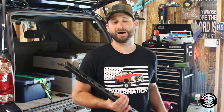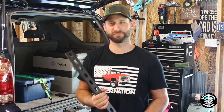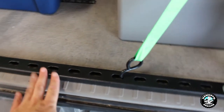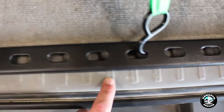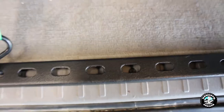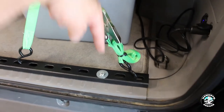So let me show you how I bolted it into the back of the 4Runner. If you don't have a 4Runner, maybe it'll give you some ideas on how you can bolt it in the back of your rig. Nothing real special for the piece right here, and it does clear the trunk when it closes perfectly. This is your trim piece from the factory, and right in there you can see there are about six Phillips screws that hold that into place. So what I did was I pulled the screws out of the ends on both sides and then I just drilled a hole all the way down.